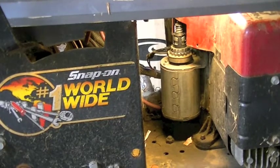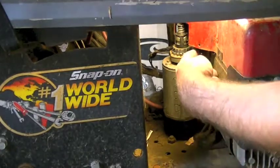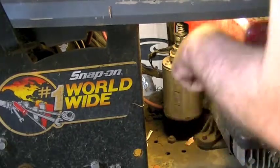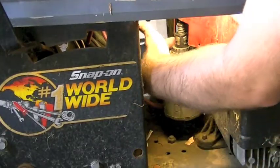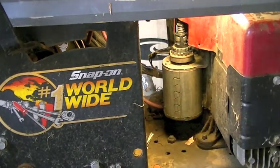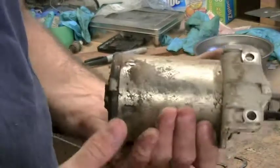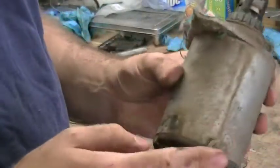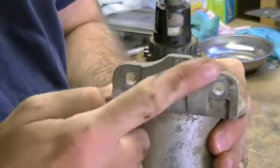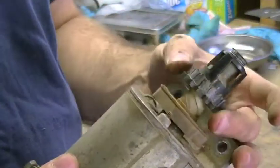There's a 13 millimeter bolt that comes right out, and one directly behind it, plus an 11 millimeter that holds the wire on — that's your main positive lead to the starter. Here's the starter motor out of the lawn tractor. This bolt had the main positive lead on it — put the nut back on so you don't lose it. These were the two bolt locations that held it to the block, and this right here is the culprit of the grinding sound and the failure to start.